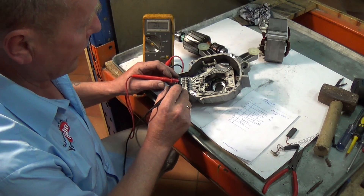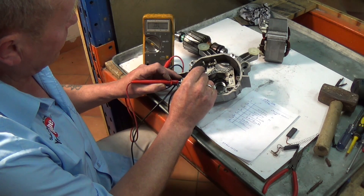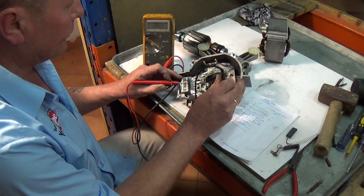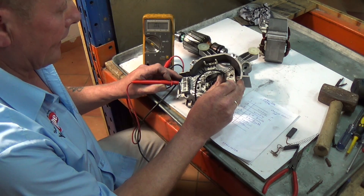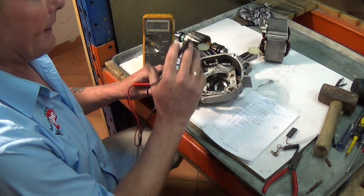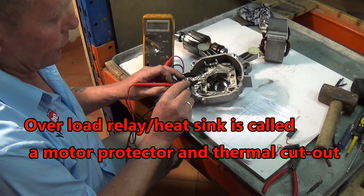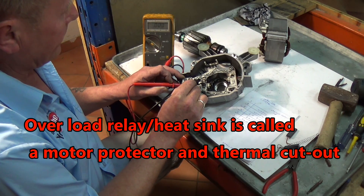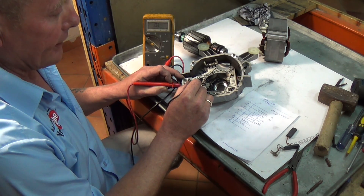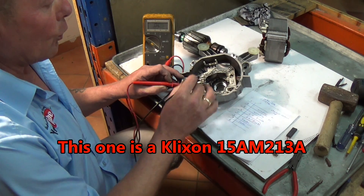Terminal two and three go to the windings, either on this side or the top side. I'll check the middle here - number two should be that one, and number three should go down to the other side - that one there. So we know the stator windings are good. Number four goes to the left-hand carbon brush. With the plate over it's on the right-hand side - that is our terminal for the carbon brush. We want to make sure the heat sink is good, so number four goes through to the left-hand side. We have continuity there, continuity on the outside, so the heat sink is good in this machine.